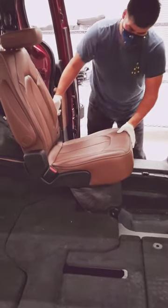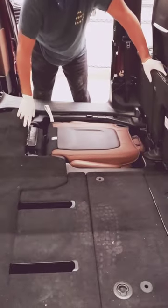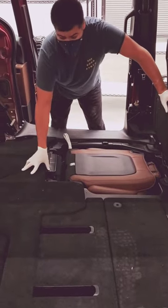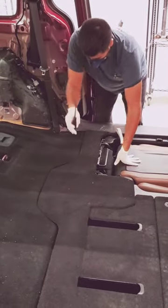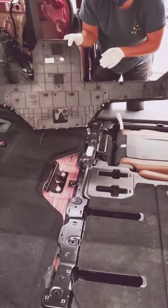Go ahead and remove the middle seat first and stow it away. Then there's a series of bolts attaching the frame — first we need to remove this middle carpet part. You're going to need a tack remover or some type of chisel to pop through it. It's going to be really loud; don't be scared. Most of these clips are going to survive.